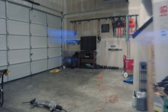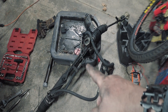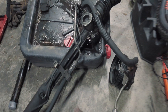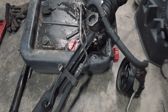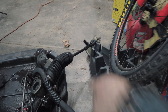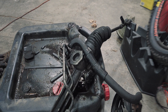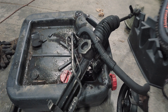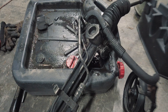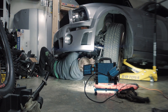Got the rack out. I left the tie rod ends on their wheels, got the pump out, and got the tank out. So now I can probably try and figure out how to get the new rack in there and slowly get everything else reconnected.